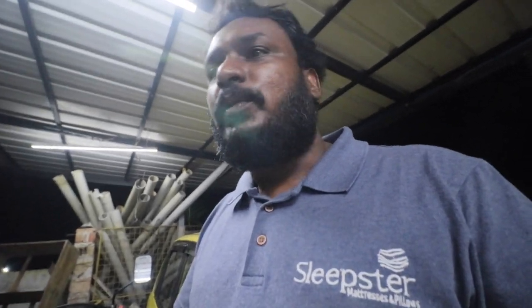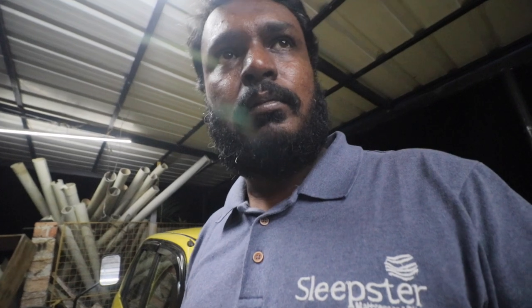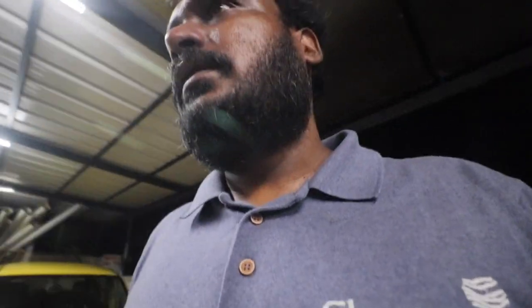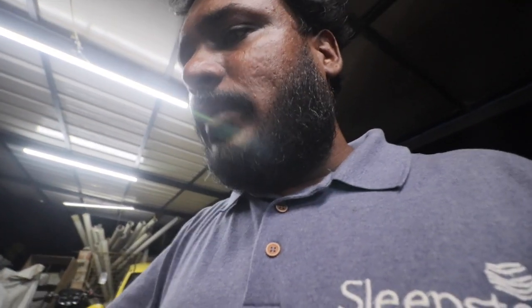Another thing is, the RD350 has an exhaust leak from the left side cylinder. So I'm thinking I'll do a permanent fix. I'm more inclined towards a helicoil. Once the shops open, I'll get a helicoil made for it and then put that insert. I'll also get an original RD350 stud and use that instead of the oversized stud which it has as of now. Apart from that, it will require some bit of plating, as I have to remove both the silencers. I also have to change the rims on it. So those are a couple of things which need to be done.